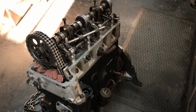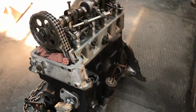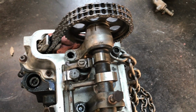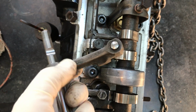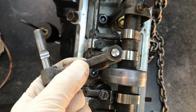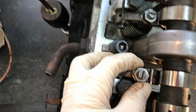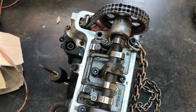Now then, 190SL, this is more complete clearly, and something that I can identify with a lot easier. So this is what your engine looks like when it came in. One thing we're going to refresh is these rocker arms and the shaft, and when we get done with them, there is no lateral movement or play in them. I'm going to recommend that we go through yours, because you can see yours move back and forth way too much. So we'll take these off and refresh them.